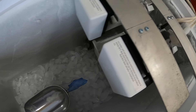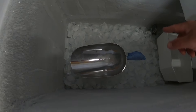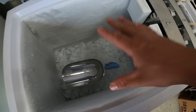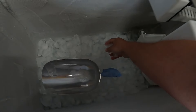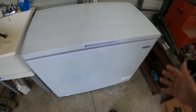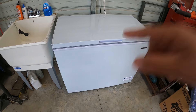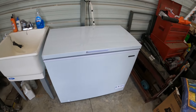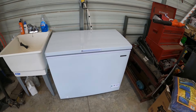If y'all look in the bottom, it's been busy. These do not make nowhere near the production of the big $2,000 or $3,000 units, but I probably have 90-plus pounds of ice down there — about a foot deep right now. It does not stick together at all, and the reason is because this always stays at zero degrees. In big commercial ice makers, the reason ice often freezes together is because they run at about 32 degrees, so there's melting and then refreezing. I have yet to find a single two pieces stuck together on this one.